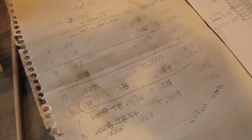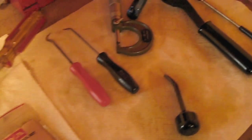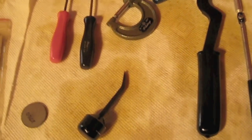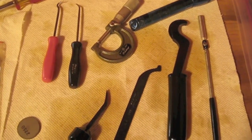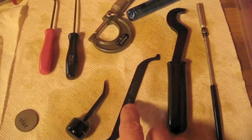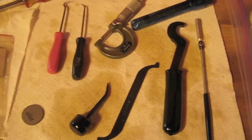Any valve found to be out of clearance — you remove the shim and measure it using these tools, which I'll explain later. There's the tool I use for removing shims, the tool for holding the bucket down, and of course a micrometer, some picks to pop the shim out, a magnet to grab the shim, and a flashlight so you can clearly see when you place the holder for the bucket.